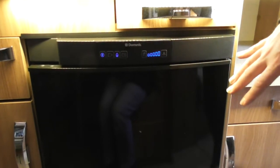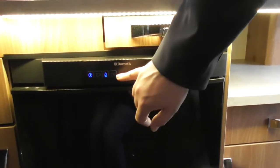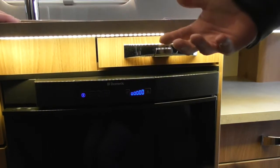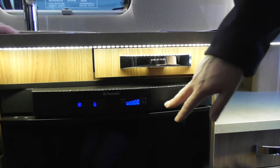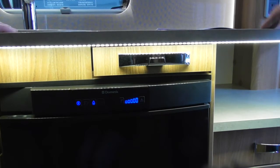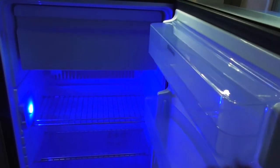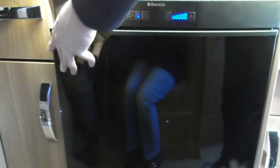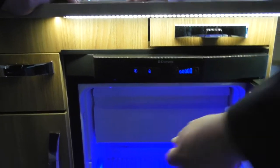Then your lovely fridge. The haul-off on the end is similar to your old fridge. You've got three power selects: electric, gas (the flame symbol), and battery for when you're towing. For gas, if it doesn't light it will flash — all you do is press the rubber button on the end and it'll automatically prime and ignite itself. The fridge has a freezer box in the top. The new-style catch — you push it in and slide it out, and when you push the door it keeps it closed. When you're leaving it for any period of time, use the catch to keep the door ajar so any spilt milk doesn't turn into a problem.